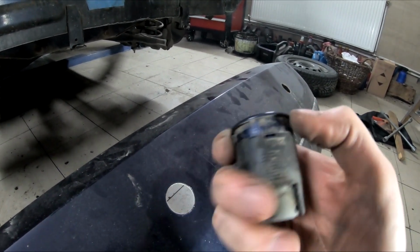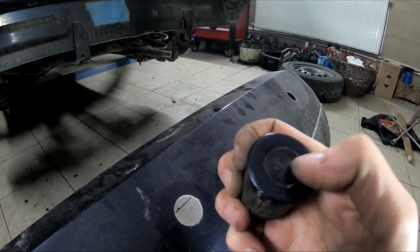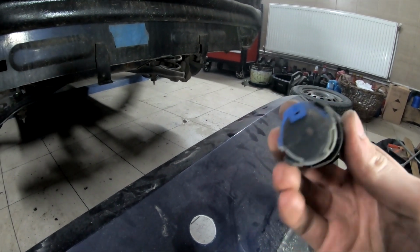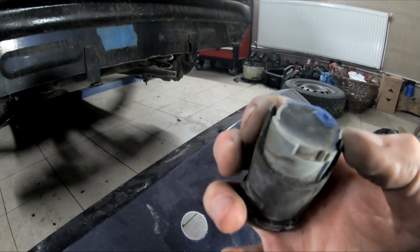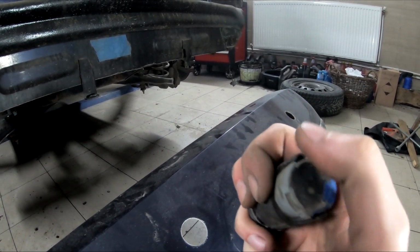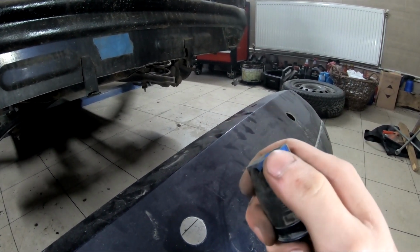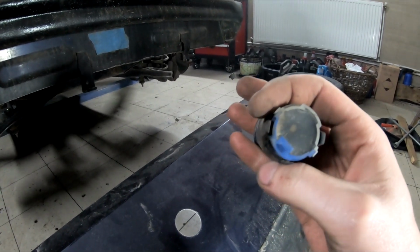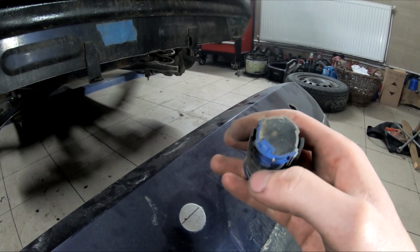And what you need to keep from the sensor is this front blue ring, because we will reuse these. And to take the sensor out of this other holder, you will need to move this and this towards the outside, and then you can push the sensor out. It's not that complicated, but give it a try and you will probably do it pretty easily.